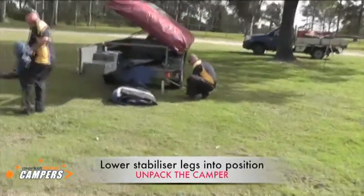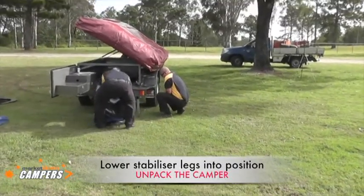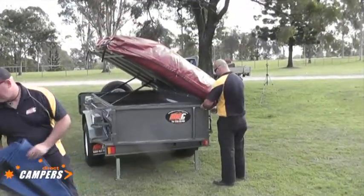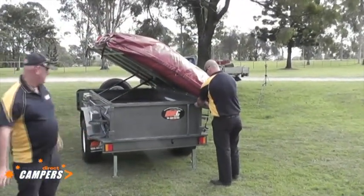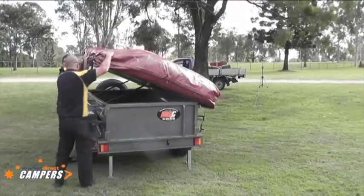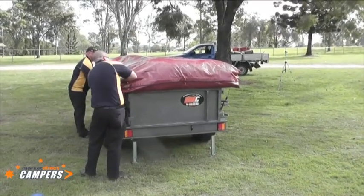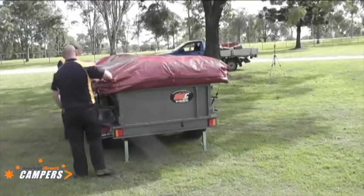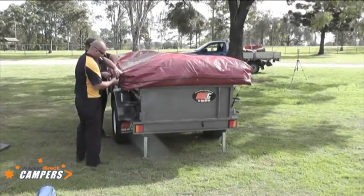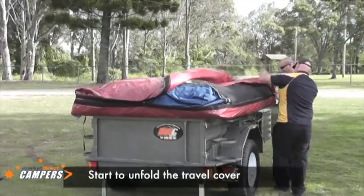Michael's removing the goods from the tent while Keith winds down to stabilise the leg. Best idea when you open up the tent is to keep the tailgate shut — less things to move around yourself. When lowering the top on the trailer, do not let it drop; let it lower down and make sure the latches are done up. When you do the latches up, make sure they're firm but not over tight — they're not meant to be over tight to pull down for a seal.